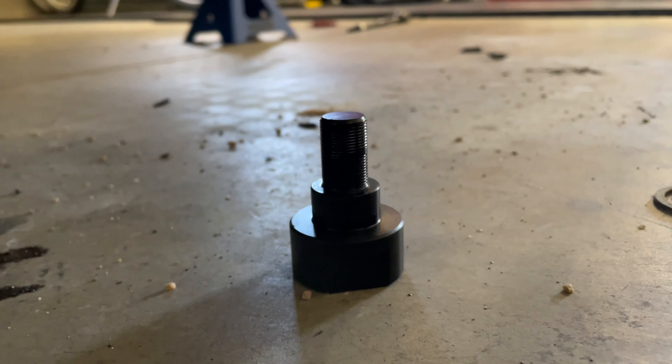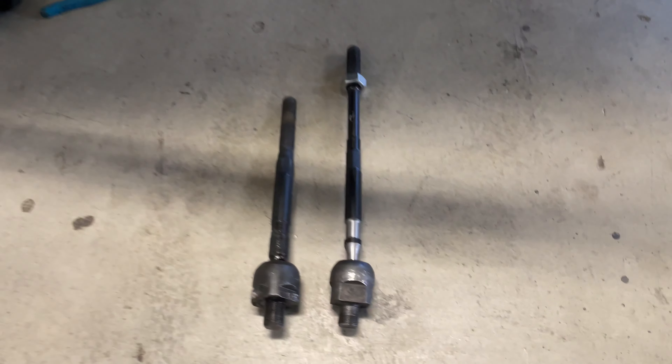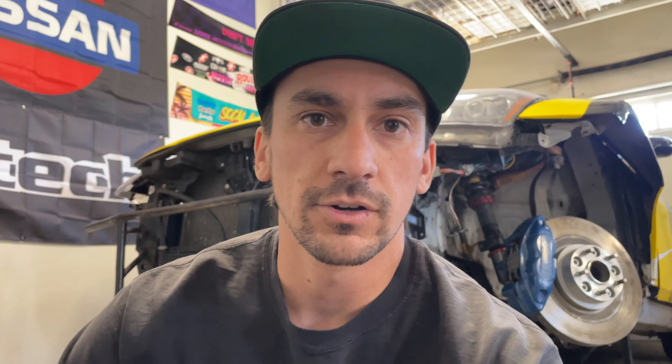They're actually a little too long, so I thought, well, that's not a big deal — I just won't run a tie rod spacer. If you're not sure what a tie rod spacer is, I'll cut to a little video of that right now. This is an S14 tie rod; that is a stock 350Z tie rod. I could have made those tie rods work if I ran no spacer. GK Tech gives you a spacer with their bolt-on angle kit — typically you'd run one on one side. But looking for more angle, I decided to run none and just do longer tie rods.